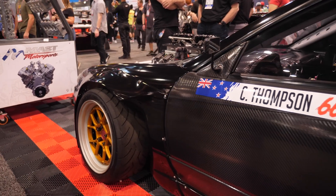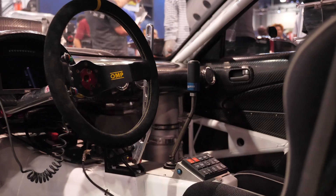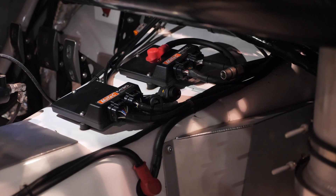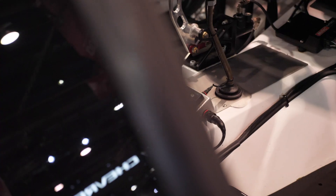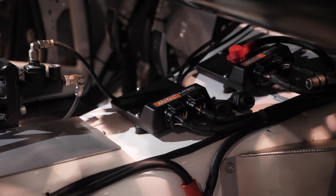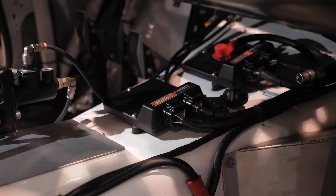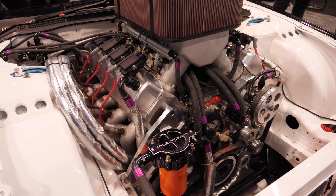The engine needs to be managed, and with 850-odd wheel horsepower you want accurate ignition timing and fuelling. I run a GPA M130 MoTeC and a PDM30, and then I've got the AFR4 Emtron CAN boxes for the lambdas. The M130 is the ECU controlling the engine — it's a general GPA package, nothing particularly tricky, off-the-shelf stuff. We can see in the exhaust primaries there that you've got individual cylinder lambda sensors, going through the Emtron CAN lambda controllers.